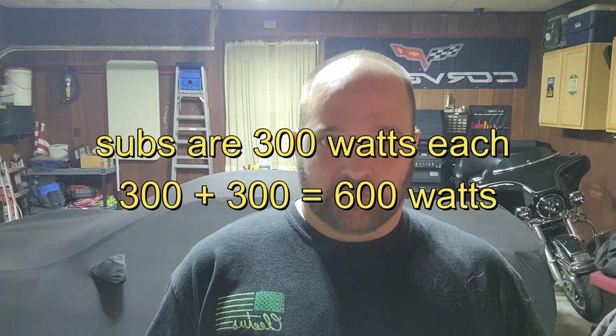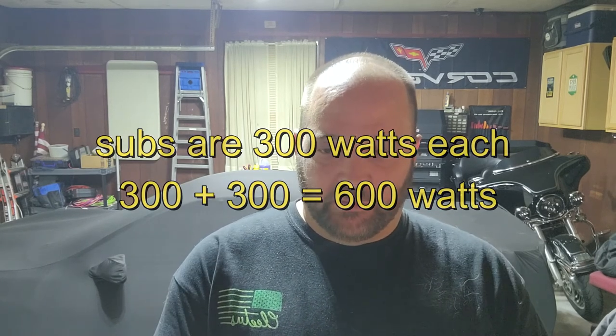The way that I got the sub set up, as I was showing you on the test bench, each sub is 300 watts, and they're 4-ohm subs, so when you put them together, your ohm load, your impedance is going to be 2 ohms. If you look on forums like crutchfield.com, what you want to do if you're running two subs is you want to take your RMS wattage of each sub and add them together. So each sub is 300 watts RMS plus the other sub 300 watts RMS. You get a total power output of 600 watts RMS.